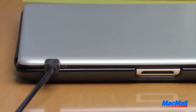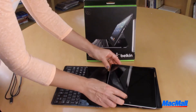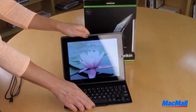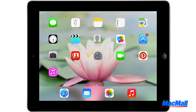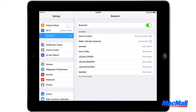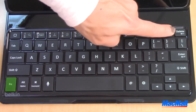Now you're ready to sync your keyboard with your iPad. Slide in your iPad into the casing and snap it into place. Use the magnetic slots to place your iPad in the most comfortable viewing angle for you — there are three here to choose from. Now on your iPad, go to Settings, Bluetooth, and turn on the Bluetooth. Then find the Belkin Ultimate keyboard on the pairing list and select it. You can also connect by simply pressing down the function and pair key.